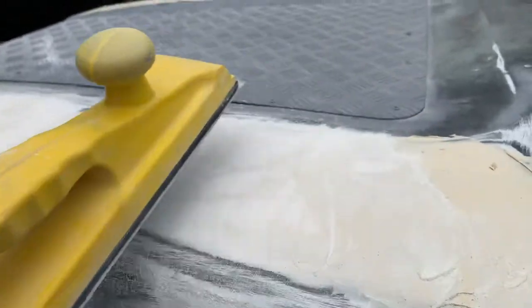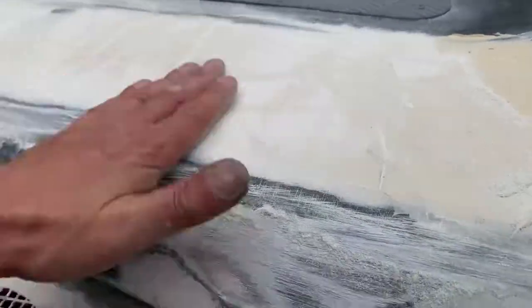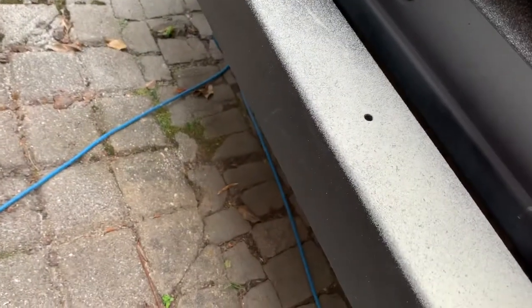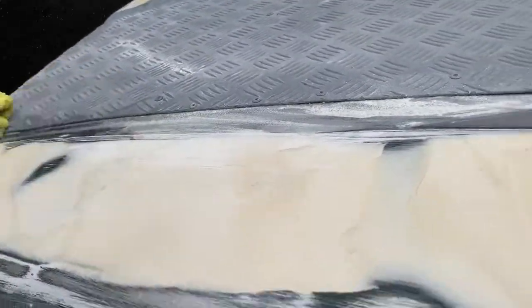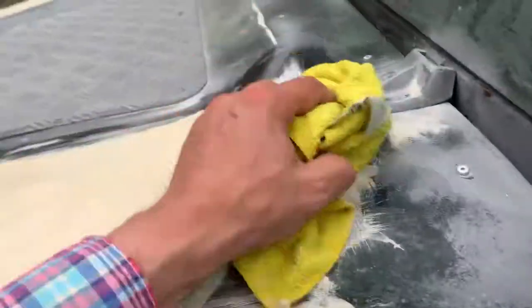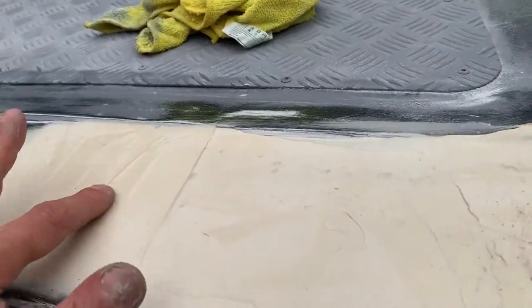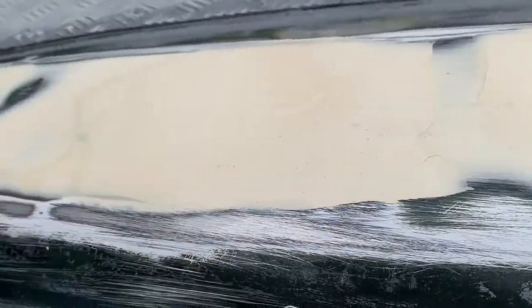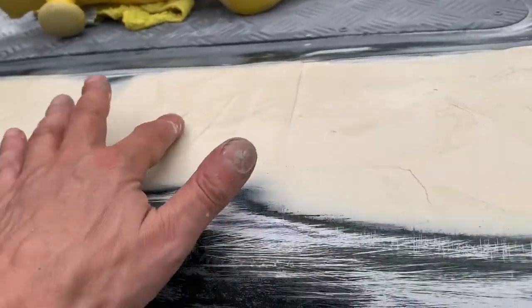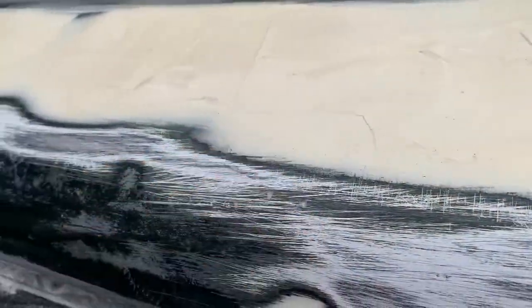You can see it's still low there. I wonder if a wet rag would do this — let's try a wet rag to see if that'll show the low spots. So with the wet rag you can see I've got lumps there and lumps there — I'm a little bit better now. This is porous stuff so you've got to dry it really, but you can see now where the low spots are. So when it dries I can put some filler in this bit here, because that's obviously not being touched by the plane — that's definitely a low spot. This is definitely a low spot too — wasn't being touched.